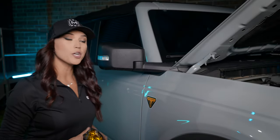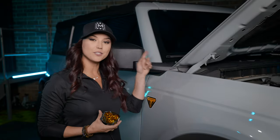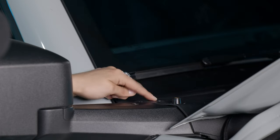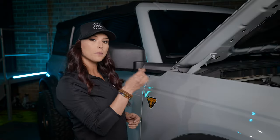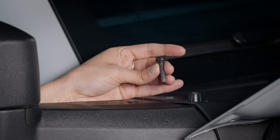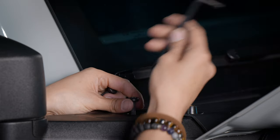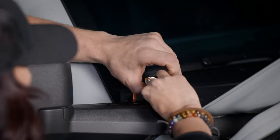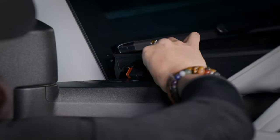Now with the harness ran, we're going to go ahead and get your A-pillar brackets mounted and your four-bangers on. First things first, remove these two bolts right here — you'll be using a Torx Plus I-30. Once those are removed, just lift up on this plastic trim piece and pull your four-banger harness up and out.